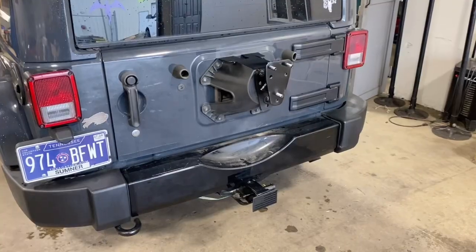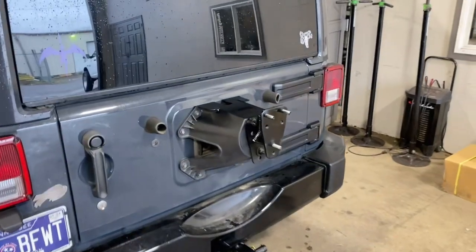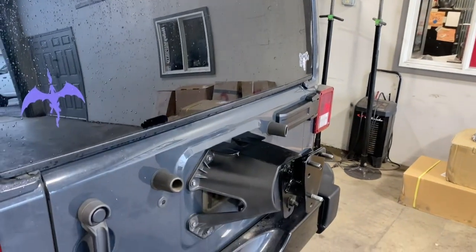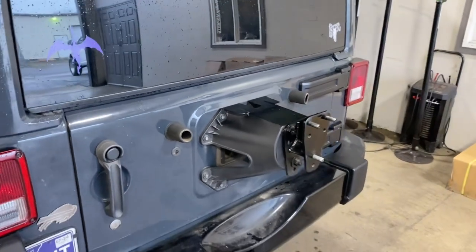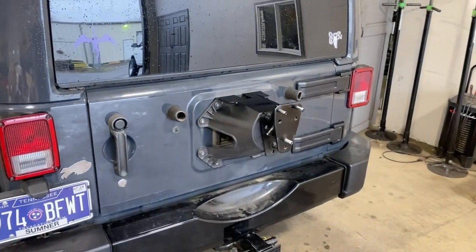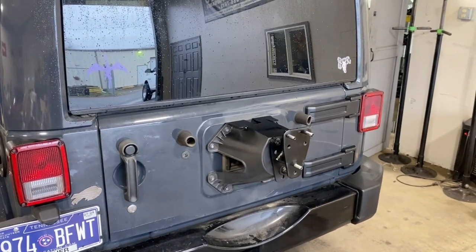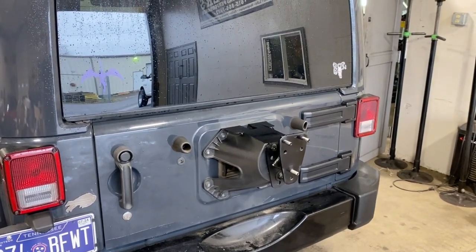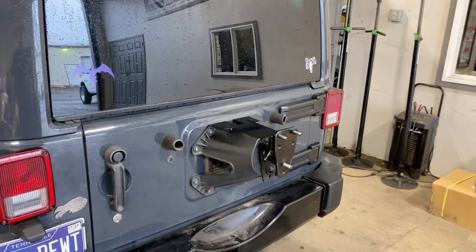Went ahead and trimmed off the top portion of the third brake light. It's a cast aluminum piece — you just cut that off flush and then terminate the wire inside the tailgate. I always put the grommet back in. Went ahead and put a spare tire relocation bracket on as well. These 18-by-33s aren't going to be that heavy, and it's a budget-friendly alternative to an actual tire carrier — with the 33, not as critical.